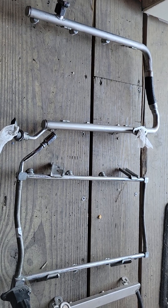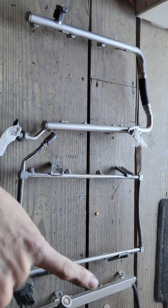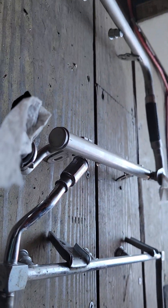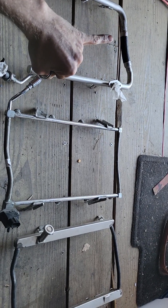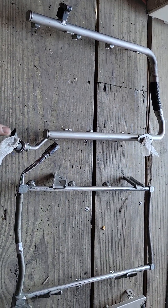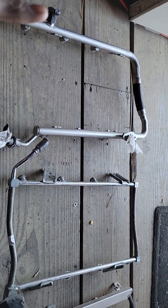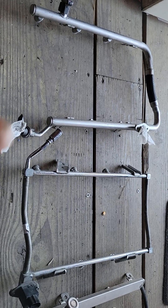That's what you would have to do to run it on like an F-150 or a Windstar intake — rotate this sensor. On a Windstar you would want to run this type with the return style fueling. In between these two, it comes down to the same benefits of having quite a bit larger volume — you're looking at three to four times the volume in the same fuel rail. The crossover for the fueling is the same size as the rail to ensure a really good fuel rail reading at the return style. When you have your fuel pressure regulator on the return line, you're just going to have a really good read.